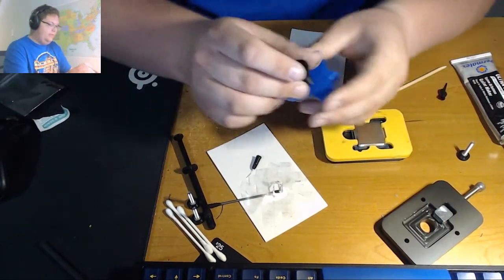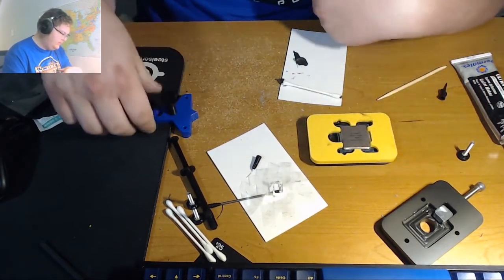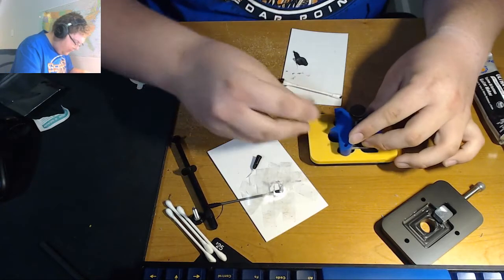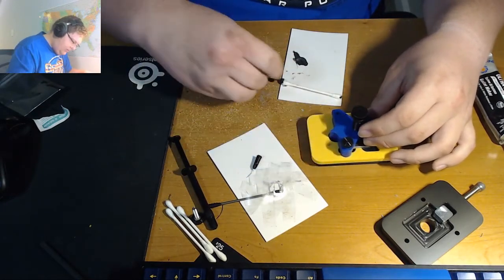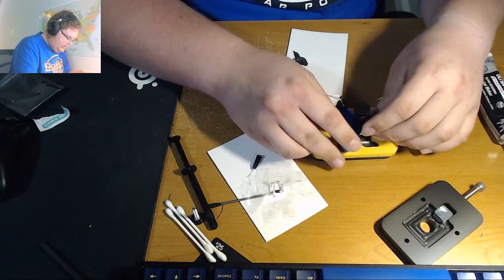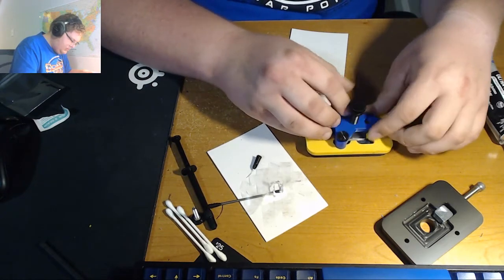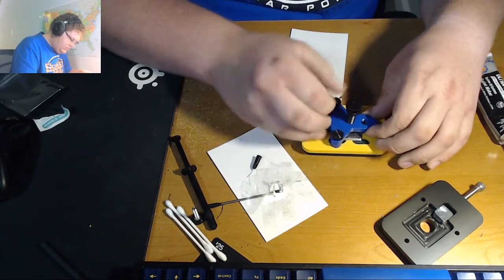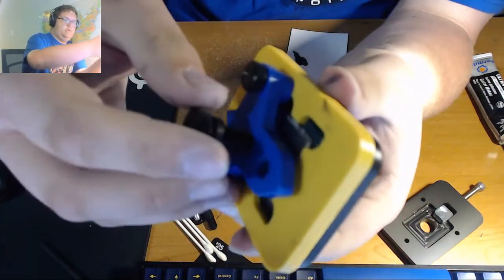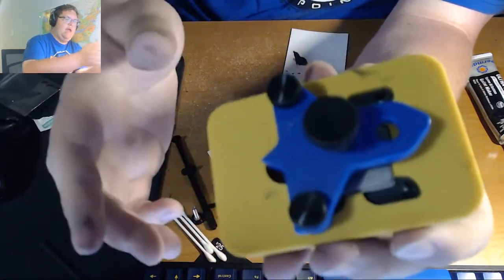Then what you do is you take this tool, which would usually have this little screw, nut, whatever, not attached, and then 2 of these screws, and you just position it over the holes here, because there are 2 little screw holes in the tool, and then just screw those in and tighten those up just to get it aligned properly. Now that it's aligned properly, you tighten the big screw. And then once you start to meet resistance, half a turn, and then you're good.